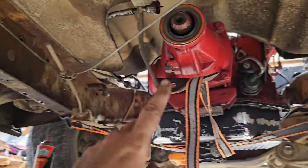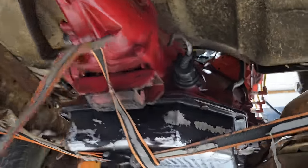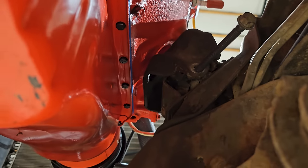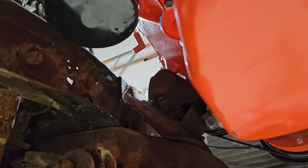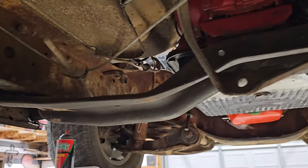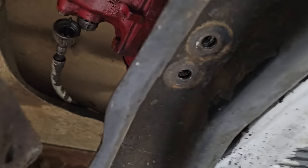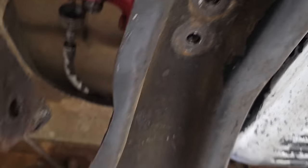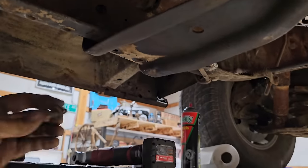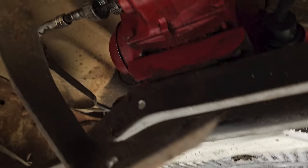Okay, I'm gonna put a pull jack under here, lift this up, get this cross member in, and I think that bolt will slide right in. It's already fairly close. This one's already in, and then we'll have this thing bolted home. Well, this was going pretty good, actually, until I discovered the transmission mount is absolutely hammered in there. Just stripped, and I didn't notice, but the hardware I took out, wherever that is, oh, it's just smoked.